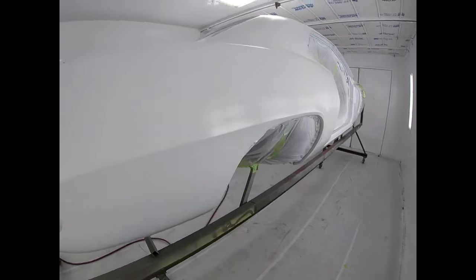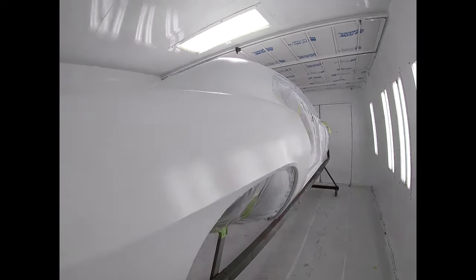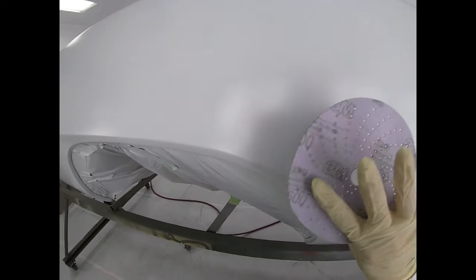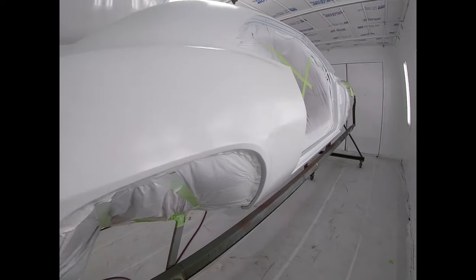Once I've got some base on and I like the look of the base, once I've got my first coat on, look it over for any nibs that you see. Take a little 600 grit and just rub them out, because that base coat is going to sand a lot better than sealer. Sealer doesn't sand very well at all.